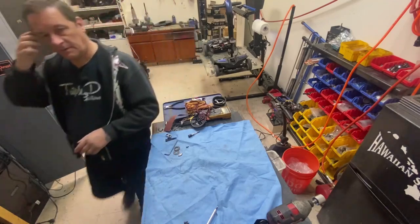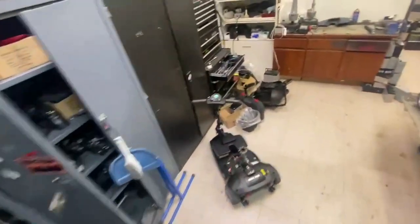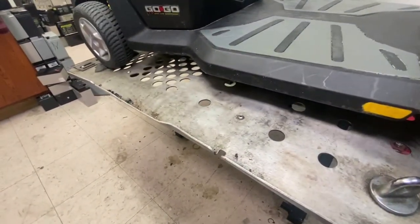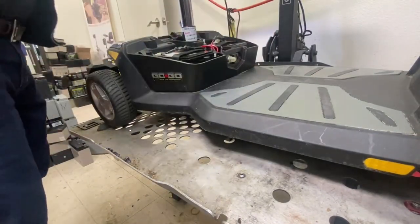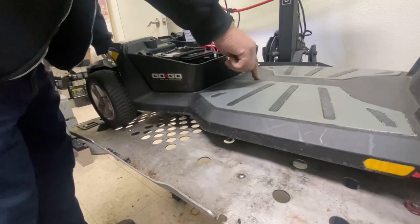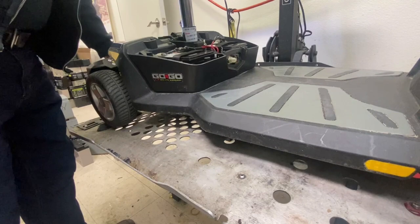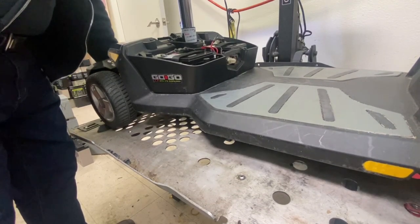Okay, you can probably hear that. It's nothing special, it's what it's supposed to do. Okay, hearing the click of the controller, that's the first click. We'll remove this. So that's the click you hear of the relay in the controller. And the second click you're going to hear, the louder one, is the brake releasing.